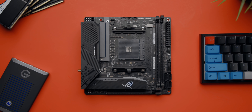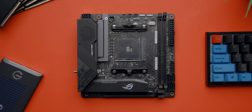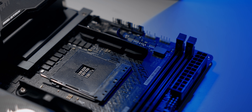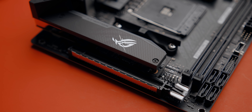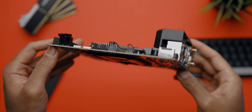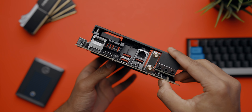Housing the CPU and the cooler is the Asus ROG Strix B550i Gaming. This board is jam-packed with everything Asus could possibly fit into a small form factor. It has an 8+2 phase PWM design that's actively cooled by a fan, and it's also the only motherboard in its entire lineup that supports memory speeds up to 5100 megahertz. The primary M.2 slot is right here with the heatsink. For connectivity, you name it and this board has it — there's Wi-Fi 6, an Intel 2.5 gigabit LAN port, plenty of USB 3.2 Gen 2 connectors, and a built-in IO shield.